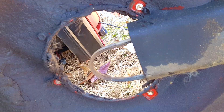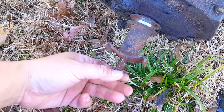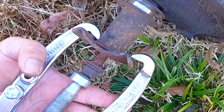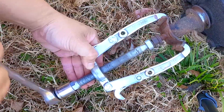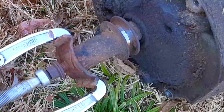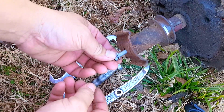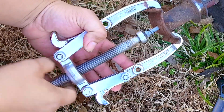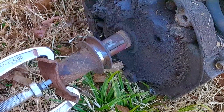One of the biggest hurdles is finding a good engine to put on the mowing deck of your choice. In this case, both of these mowers were free and found online. The Toro was beyond repair as far as the engine goes, and the Black Max was fixable, but I would have had to spend well over $100 to get it working well enough to be sold as a working unit. I could have converted it to a push mower, but I would have made less money on it. The Tecumseh engine wouldn't start because of low compression, and the Honda engine from the Black Max runs but it's not 100% either. However, once I put it on the Toro's mowing deck, I'll at least have a working machine I can sell.